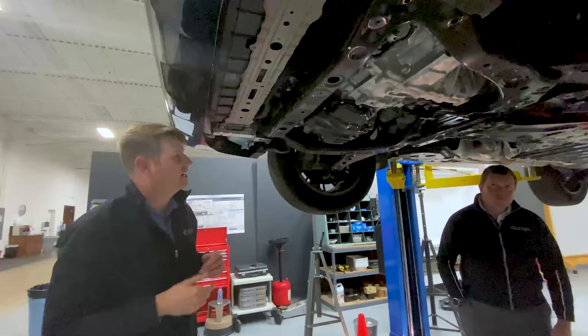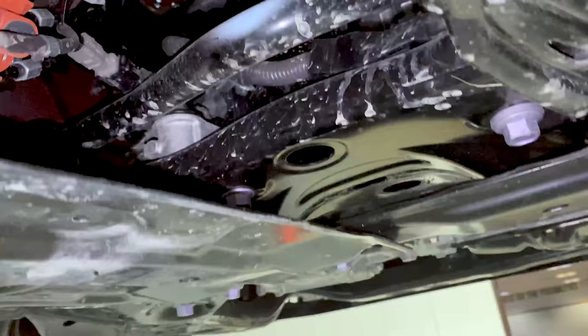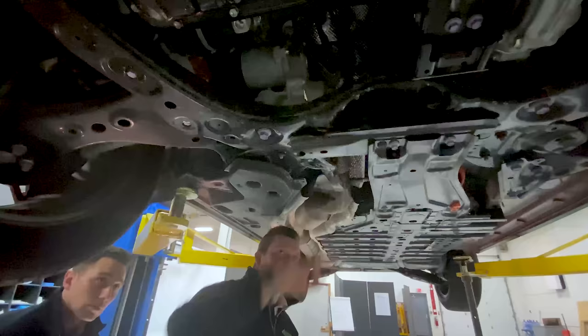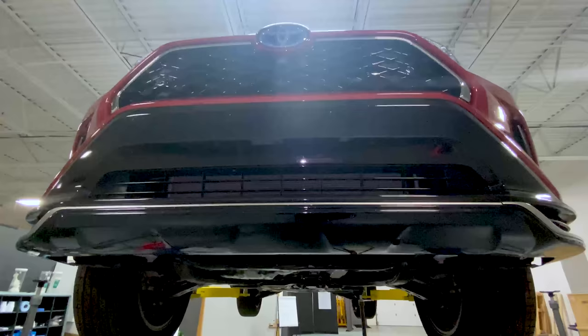This helps with lightweighting — a very prominent feature in Toyota's high capital investment stamped body structures. You start to see similar strategies on some newer GM platforms. Toyota is also very good about reusing components across high-runner and low-runner vehicles. Notice this hump on the cradle: on high-runner V6 variants exhaust flows underneath, but this PHEV has the exhaust flowing over the cradle. The hump still exists because they're reusing that cradle, even though a PHEV like this is heavier and may require a stronger cradle.